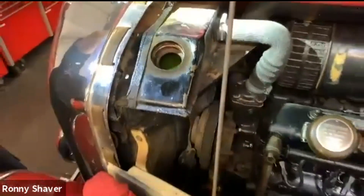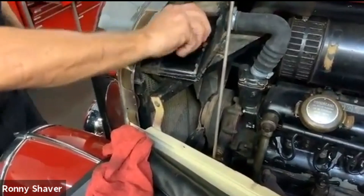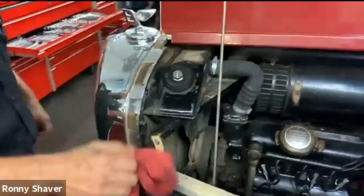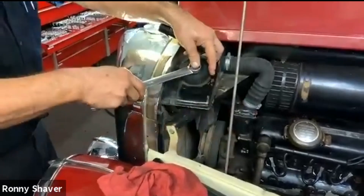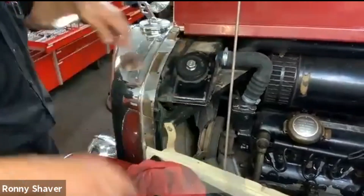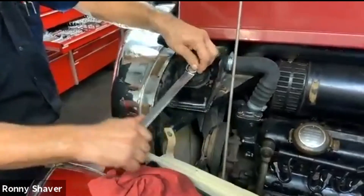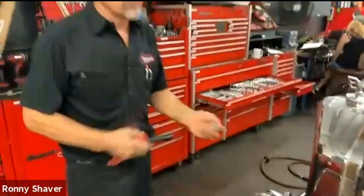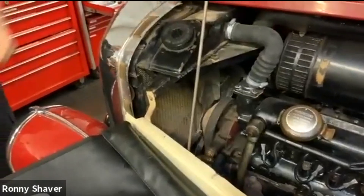These tanks you don't want to get too full. This system has a little pressure relief valve — it's like a one or two pound spring-loaded valve on top. But anytime you see an old radiator with a big tank on top, never fill it to the top, because they don't typically have expansion tanks. The coolant expands as it gets hot and it has to go someplace. That's why there's a big air gap — it just compresses air up to the relief pressure.